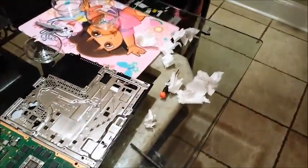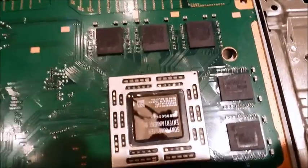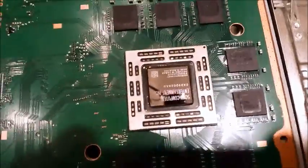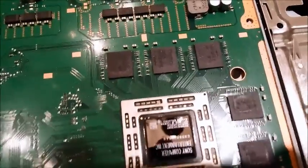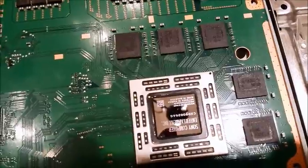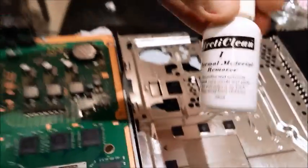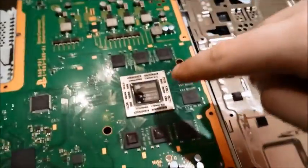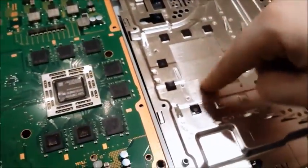We're back again, as you can see all the papers and folded up papers everywhere. We just cleaned the chip — that's a reflection on the ceiling you see, not drippage. I actually thought it was a drip on there. That's the reflection — it looks like a mirror now, you can actually see my head in the reflection of the chip. That's how clean it is. You wipe the majority of it off first, use this to break down the rest, then use this — it's a purifier, it readies the surface for new thermal paste. I put some of that on there and on the contact point.